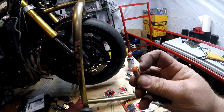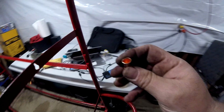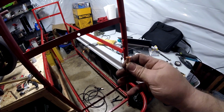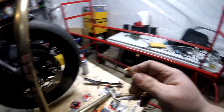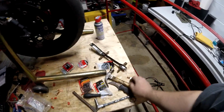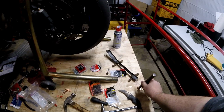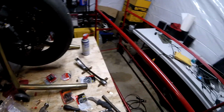And the other end of that ground cable here, I'm going to have to solder it with a torch. I won't be able to take it in the house and solder it because I didn't prearrange the length and take this in the house and solder it when I soldered the positive one. So what I'm going to have to do is get the length figured out, take the punch and the hammer, and just like I did up here on this piece of metal, kink it in there. I'm going to just do that right on the frame of the truck. I'll take the hammer and the chisel, lay this up on the frame of the truck, and wham, do that. I won't be able to hold the camera and show you that, but I'll just kink that right on the frame of the truck, and then bolt it to the frame of the truck, and then I'll heat it with a propane torch and feed solder down into it so it's a good connection.